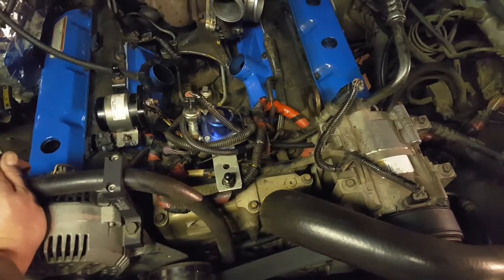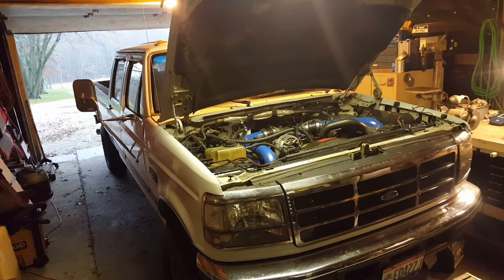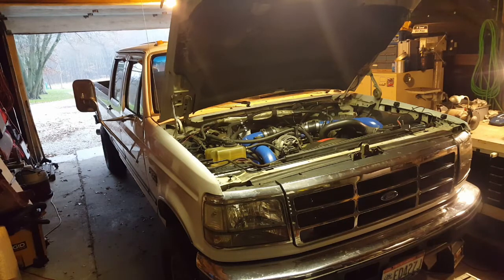Everything's back together. I primed the high-pressure oil system by filling both oil rails. Since this one also has an electric fuel pump, I primed the fuel system by jumping the relay on the fuel pump and letting it run until I couldn't hear air bubbles anymore. Just did an oil change — it's got fresh Rotella in it. The rule of thumb for starting is: crank for about 45 seconds, then let it sit for a minute or two to let the starter cool, then go again for another 45 seconds. It just takes a while to prime that high-pressure oil system and get all the air out so it builds pressure and lets the engine start. I've got a battery charger on there — hopefully keep the batteries up. Let's see what happens.